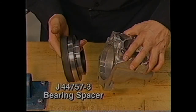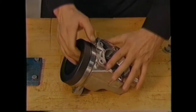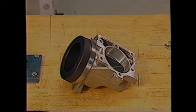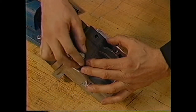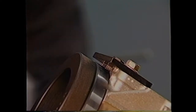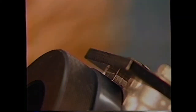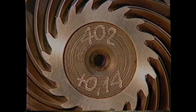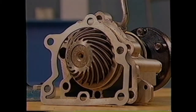Next, use a dial caliper and a straight edge to measure the distance between the end of the pinion and the surface of the extension housing. Record the dimension minus the thickness of the straight edge — think of this value as the pinion height. Then install bearing spacer J44-757-3 into the bore of the output drive shaft housing. The service information contains a numerical value representing one half of the tool diameter. Next, install the J44-757-9 to the output drive shaft housing with two bolts, then use a feeler gauge to measure the distance between the J44-757-3 and the J44-757-9. Record this dimension. Carefully inspect the end of the driven shaft — you'll find either a positive, negative, or zero value stamped on the end. This value and the other measurements are used to determine the thickness of the extension housing shim using the calculations supplied in the service information.